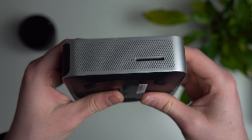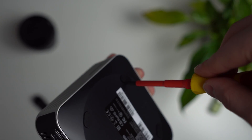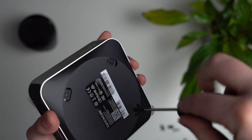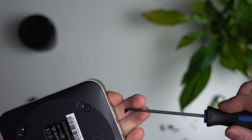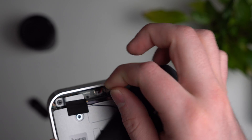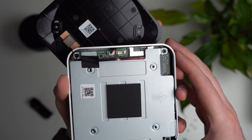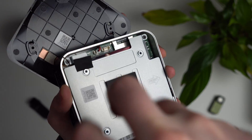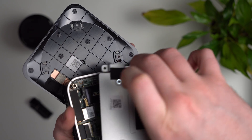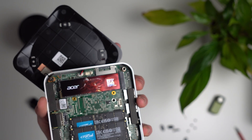You also get an SD card reader on the side, which is a nice surprise. On the bottom cover you have four rubber feet hiding the screws you need to undo. The feet are glued down but with a small flat-head screwdriver you can pry them off — it's not too difficult, though the bottom plastic cover does scratch easily. When you take off the bottom plate there is one cable to be aware of, so undo that tape bit first and then you can flip it over easier. Under another set of four screws there is a metal heat sink. Notably, both the heat sink and bottom plastic cover have arrows indicating the correct orientation when reassembling — really thoughtful.